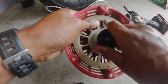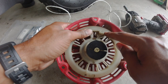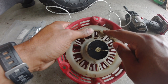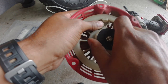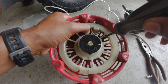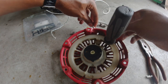This is at a stop, so I'm going to go one turn back, because you don't want to pull the string and wind it all the way back out — that's going to end up breaking the spring inside. So I go one full turn back in the opposite direction, then take your screwdriver and shove it in there so it won't unwind while you're trying to work.